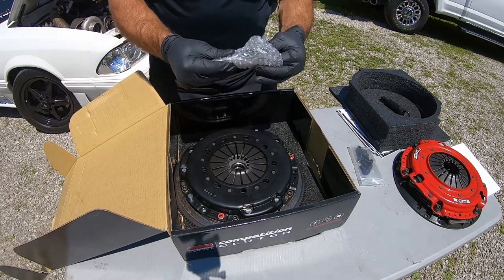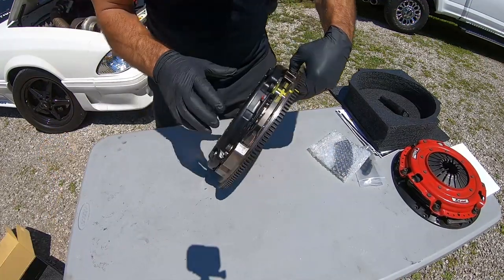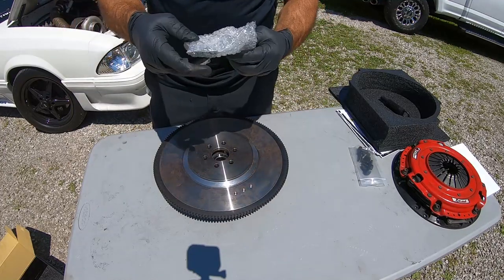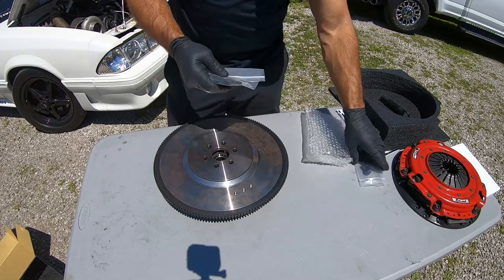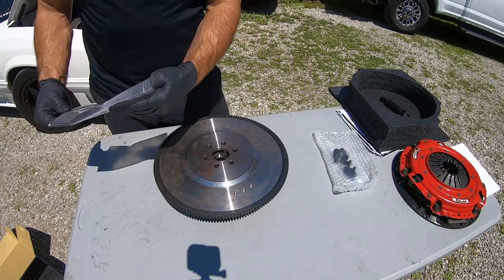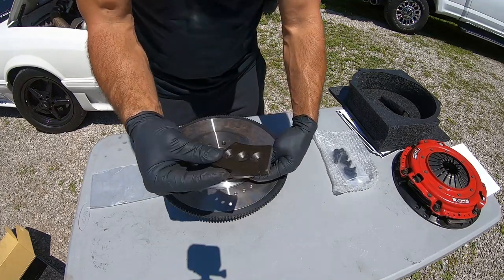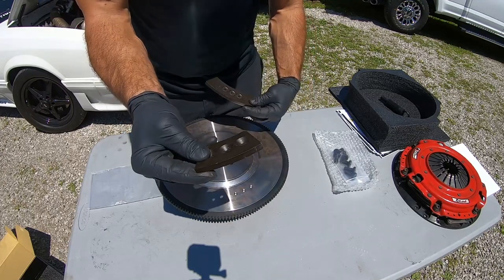This is the extra weight. We're going to go ahead and take this out right now. All this stuff has to be aligned for the balance. This is where your weight would go — this would be a zero balance. Two weights in here — pretty sure it's for 28 and 50 ounce. The bolts that bolt this in: this is the 28-ounce piece, this is the 50-ounce piece. This is for factory, and this is for stroker and 351.